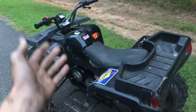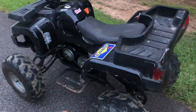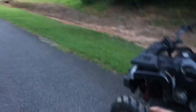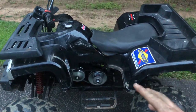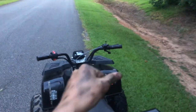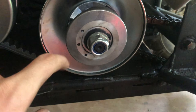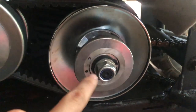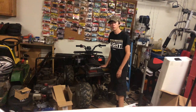This is a cheap Chinese frame and it's not built very well — not like other four-wheelers. You jump it over a bump and the frame could crack in half, which is why we had to weld a bunch of angle iron on the sides. It still needs a little more work. But I'm blown away — it's so much better than the jack shaft system. I'm also going to adjust the spring on the torque converter. There are three holes: stock position, first hole gives more top speed, third hole gives more acceleration. I'll put it in the third hole for more acceleration and more RPM. The Comet 30 series Go Power Sports torque converter on this four-wheeler definitely turned out well.